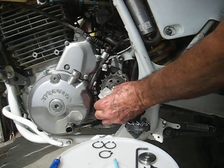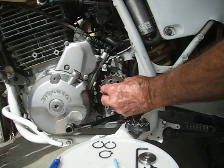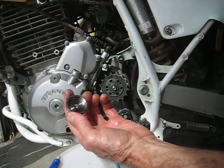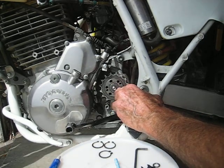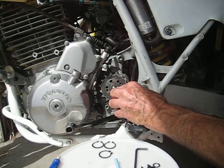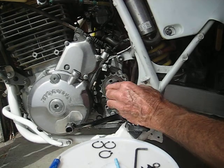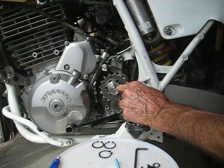I did the Arizona BDR with a previous way I had captivated it — just to keep the dirt out — but that fell off, so I came up with a whole new idea. I made this out of titanium: a threaded bushing that's knurled on the outside, held inside the countershaft with JB Weld. This goes on there with a couple of 3/8-16 set screws that jam against each other, with a drop of Loctite, giving about 10-thousandths of preload.